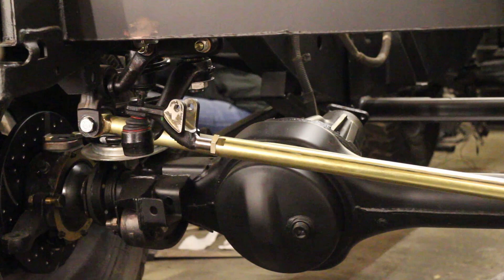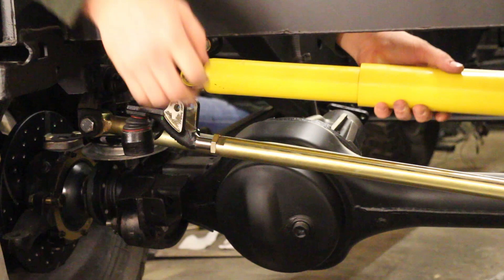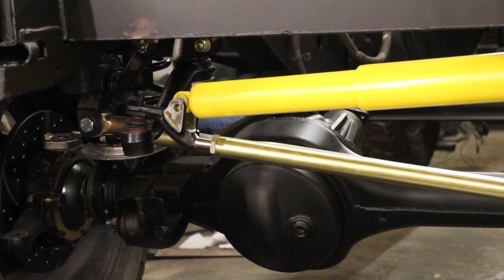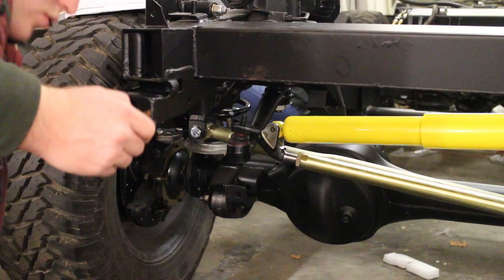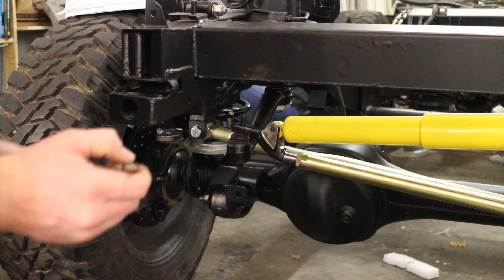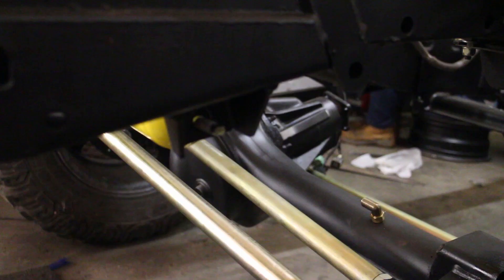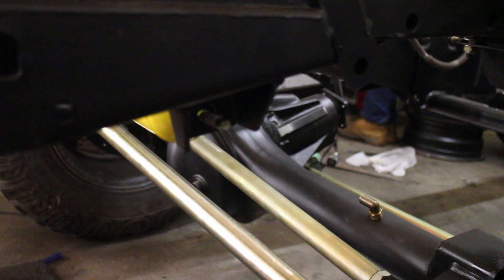This is a heavy-duty Old Man Emu steering damper which I had to modify slightly — a bit of filing on the race of the bush at the bottom to get it in. Then I used a drift to lightly tap it in; it's a very snug fit, which it should be so there's no play. I lined it up and added an M10 bolt with some copper slip or lithium grease. Tap that in place and fasten it up on the back. You also need to offer it up to the chassis, so get your washers and bushes in the right order.